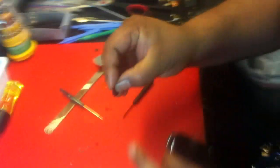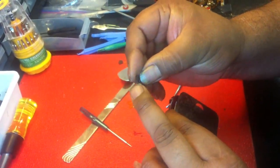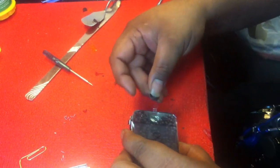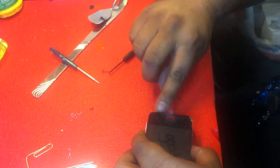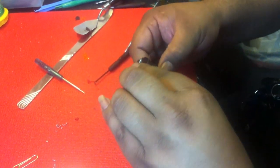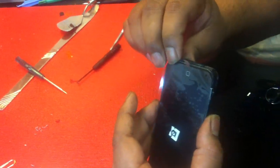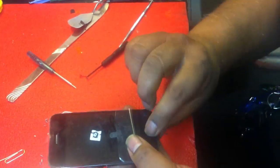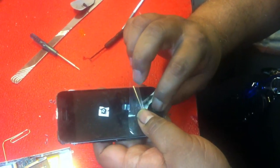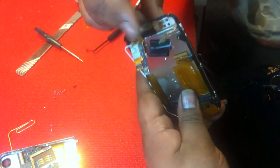The one thing you want to do is make sure you put your home button back in. There is a flat side on the top and a round side on the bottom — look for the flat part of the button and put it towards the LCD. First you're just going to sit it in. That's where the LCD gets popped in. Press your home button and see if it clicks — it's clicking. On this side, you want to tuck away your digitizer.